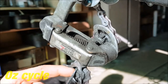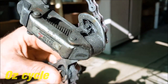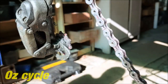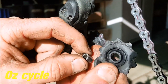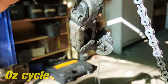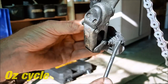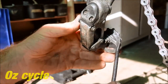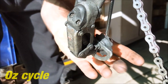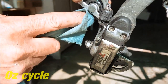These jockey wheels are neglected and in need of a good clean — there's bits of string and oil and dirt all caked up on them. If your jockey wheels are this bad, they're easier cleaned when removed from the rear derailleur. To clean the jockey wheel while it's on the derailleur, spin the jockey wheel onto a flat head screwdriver — that removes most of the junk. Don't forget to do the other side as well. You can finish them off with a bit of degreaser on the rag.